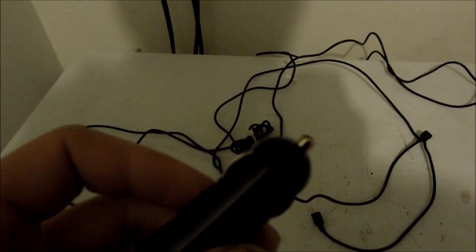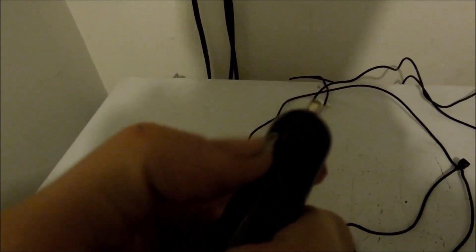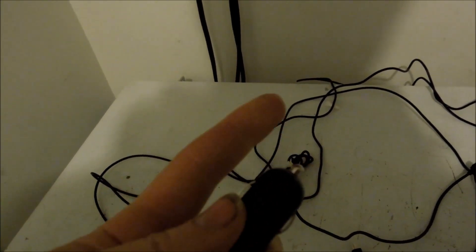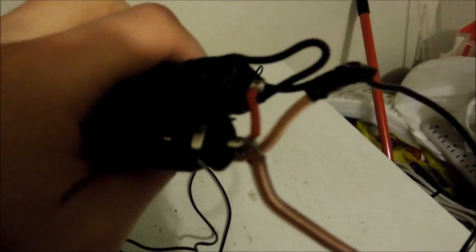I'm going to quickly show you how to wire this. When you're looking at your jacks — this is one of those, my little stubby which I keep in the car — this lapel is your negative and this tip is your positive. What I like to do sometimes is do a jumper between the two negatives and then run one black negative off, and then the positive off of here. As you can see I've joined the two tips, and I'm going to tape those up. Then there's those lapels on the side and that's where I soldered it.